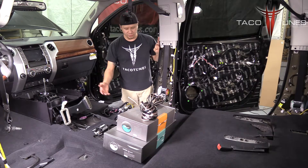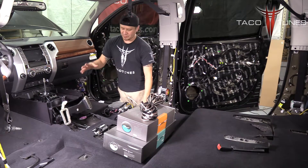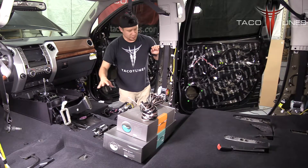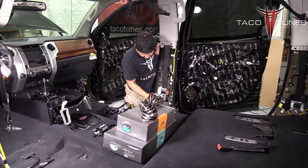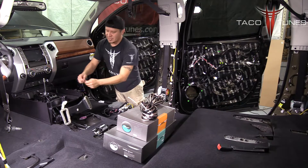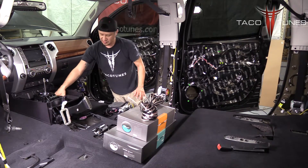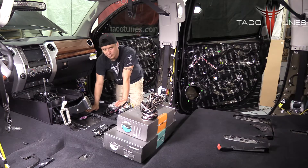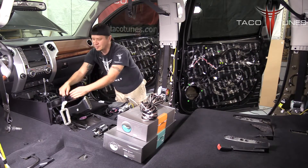You don't want to cut this wire until you have the run done. You want to leave slack so that you can connect the crossovers. You're going to run the tweeter, run the speaker — we're going to come through here. I like to leave enough slack to where you're not bent over trying to connect things. I'll leave slack to come out to the floor. If you cut the wiring, what's to say you won't cut it too short?